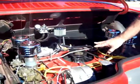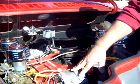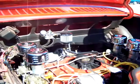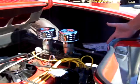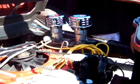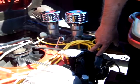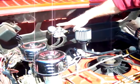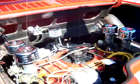Has the original fan, the original fan belt, alternator, battery, all of that is stock. About the only thing that's not stock back here is we have a high performance coil on it over here, which puts out about 45,000 volts. We have an igniter 2 in the distributor instead of points. And we have back here, this is a fuel regulator. It regulates how much fuel goes into these 4 carburetors.